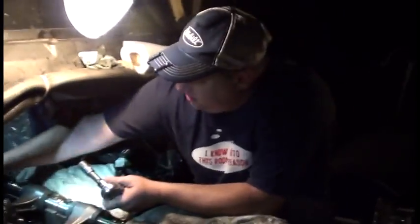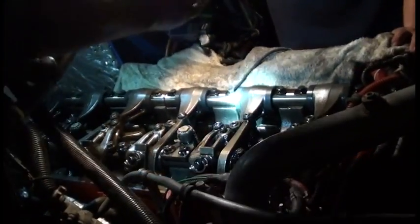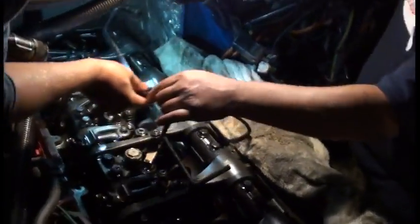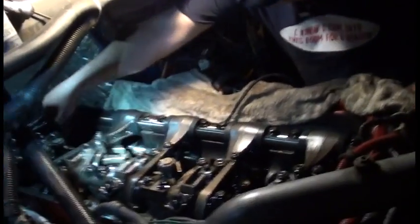Now we run the overhead on the engine - all six cylinders. The overhead sequence is 1, 5, 3, 6, 2, 4. We're not going to make a video on the overhead - we already have a video on it. Make sure you put the engine brake harness back where it goes. We'll wait for that because we're going to run the overhead first - we'll just keep that away. Make sure all your crossheads are in place.